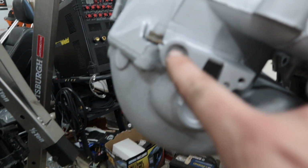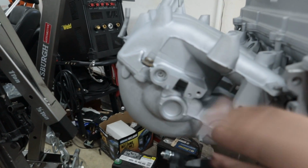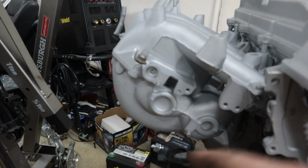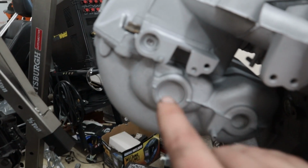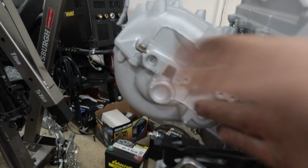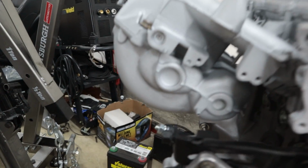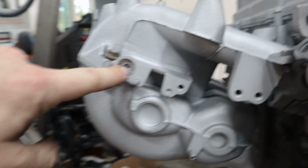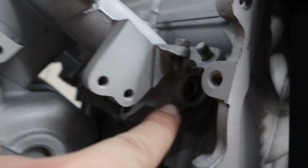I haven't mentioned this in the video yet, but the stock manifold has these little flaps. It's for emissions, and also if you're naturally aspirated, they trip the flow to get turbulent flow going into the manifold. But when you're boosted, of course, you don't want that. You don't need the variable valve, whatever. When the machinist did all this work for me, he also drilled these out and put galley plugs in them. So there's one here, and there's also one kind of tucked in there.